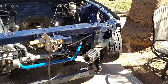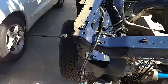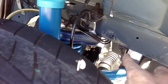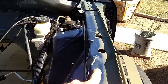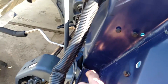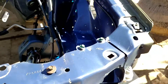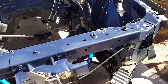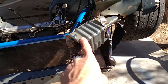I'll show you everything when it gets back, and hopefully everything's good. Then I'll be putting the engine and trans back in. We're going after fixing this buckle here, and there's a kink down here on the passenger side, and also this kink here — you can see there's this kink here — so once those are pulled straight I'll be good to go. This whole core support is going to have to come off.